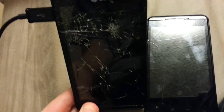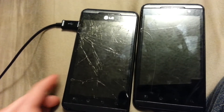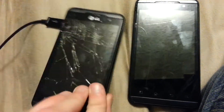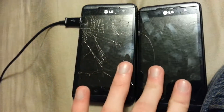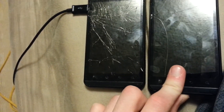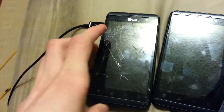I'm thinking that it might need a battery, but it's kind of odd that it doesn't have anything on the screen when it's plugged in — like it usually tells you that the battery needs to be inserted. Someone else that has this phone can test it out without a battery and see if it doesn't do anything. The guy said they both needed new screens and were functioning otherwise, so I ordered a new battery off of eBay. Once it comes in, I'm going to see if it works. After the power button, I'll just order some cheap ones and solder them in — it's actually just a ribbon cable with a button on it that you solder to the motherboard.